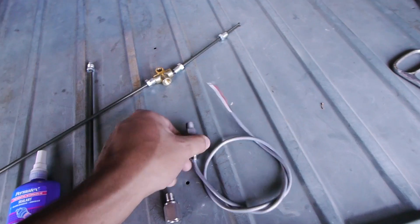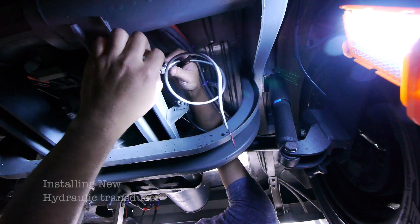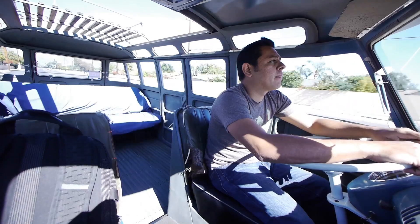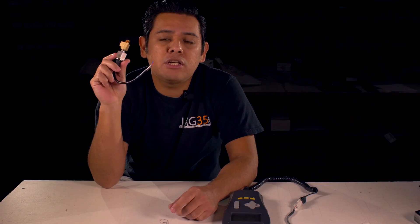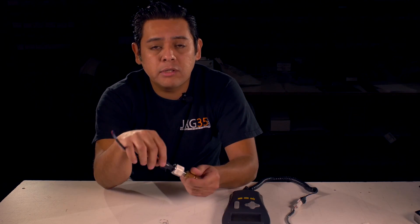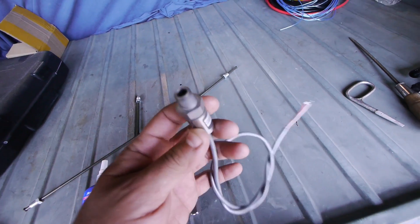And the only way to do that is by using a hydraulic transducer. If you remember back in episode 10 of the eSamba project series, I installed a transducer and hooked it all up, and HPEVS helped me turn on all the functions on the Curtis controller and tuned it all for me. So this is a generic hydraulic transducer — this one will do 1,000 PSI, which is better than the 500 PSI that I have on my Samba. You don't have to buy the premium brand like the MSC that I have; you can buy one of these. They're just as good and you can save a lot of money.